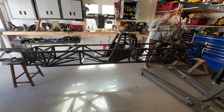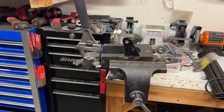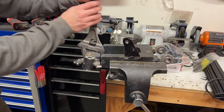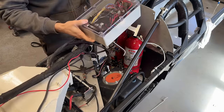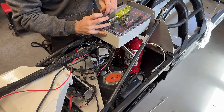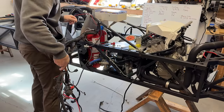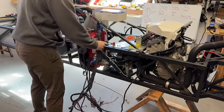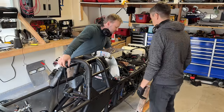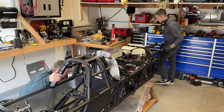The engine was the first thing to go in — thankfully I have an engine hoist I use about once a year. Since I had the front apart, I went ahead and changed the caster angle. I'd done this once before, but after driving at Bonneville I decided it needed more, especially after seeing everyone else's setup. Caster is the angle that your wheel pivots about when looking from the side — a lot of caster makes a car want to go straight, which is good because this car only goes straight. I also mostly redid the wiring. I had electronics behind the seat to keep them out of the hot engine bay, but that meant a huge bundle of wires through the firewall. The firewall needs to be watertight for rules and because I don't want to be on fire. It's a lot easier to have electronics in the back section, so I got an enclosure and had Send Cut Send laser-cut me some mounts.